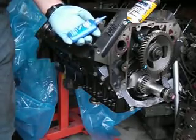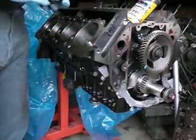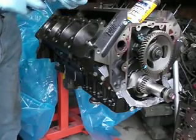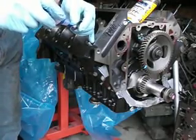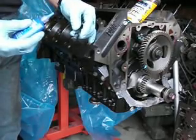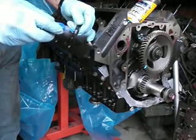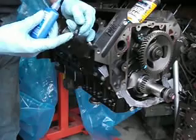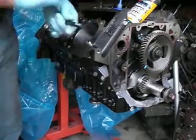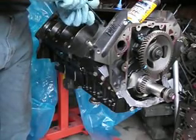Permatex medium strength — you may have your own preference, but that's just what I'm using. Make sure you shake the bottle, which I've already had it shaken up pretty good. It only takes a little bit — about that much is all you really need. I like to put it all the way at the bottom of the thread like that, so that as I'm threading it in it coats the whole thread. Then just start working them in there.